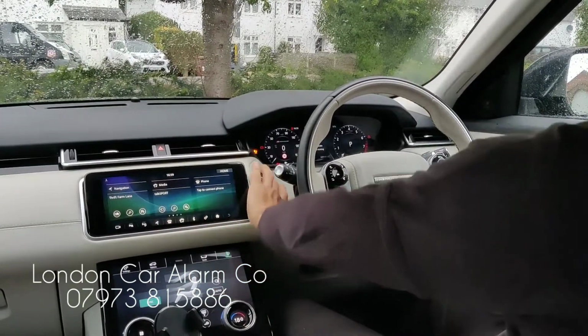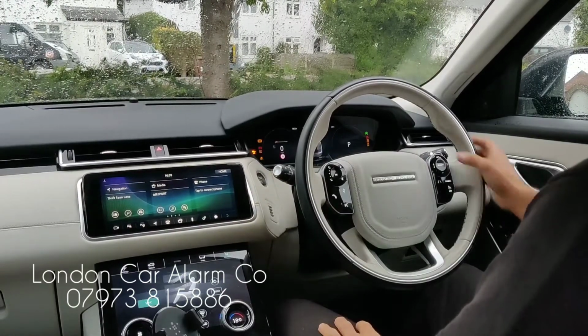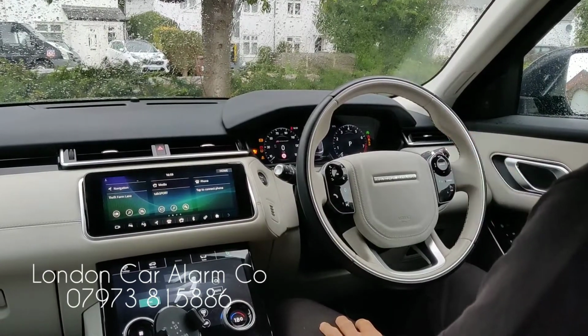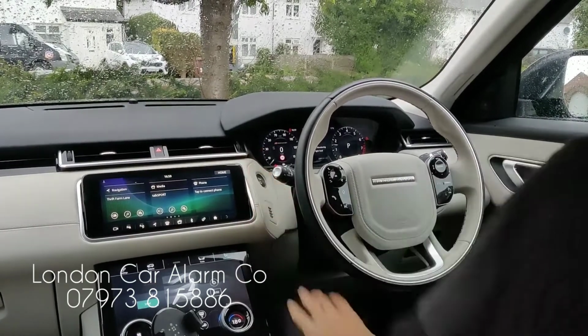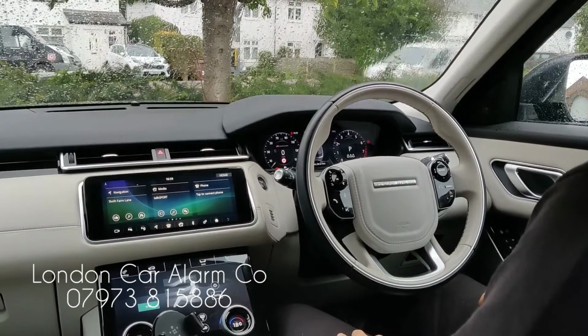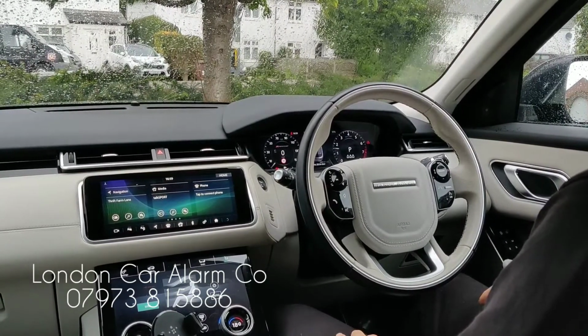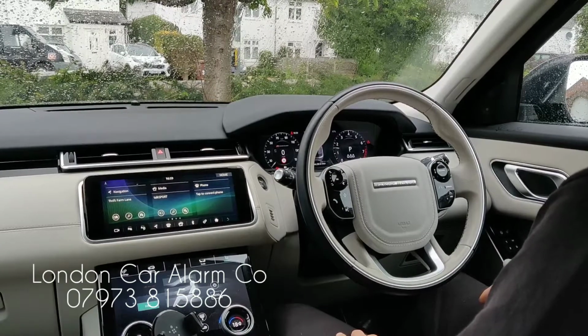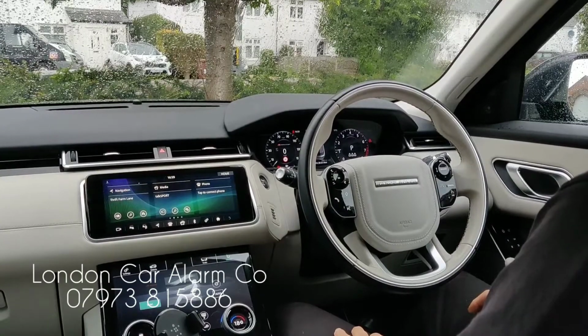No melody. So ignition off, ignition back on, new code, melody, and start the vehicle. Really clever, really straightforward. Finally, the push sequence amount, you could do anything between 3 and I think about 20. Anything over 6, you know, people start to forget.